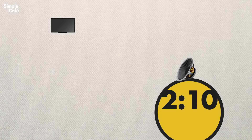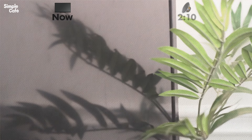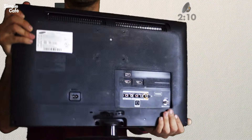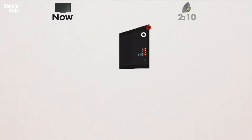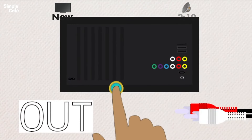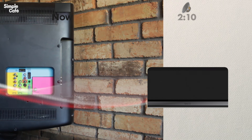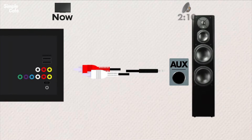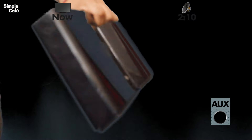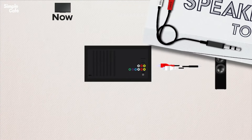First, we're going to look at video players you can connect to, and then audio-only players later in the video. Starting with what I think you're most curious about: connecting your TV. You probably saw RCA plugs on the back, but you're not in the clear just yet. Have a second look and make sure that you have a pair marked audio out. Out is the key, because we're trying to get audio from the TV out to an external speaker. Once you find them, connect the other side of your cable to a speaker with an aux input. This video is a basic look into all the things you can connect with this cable.